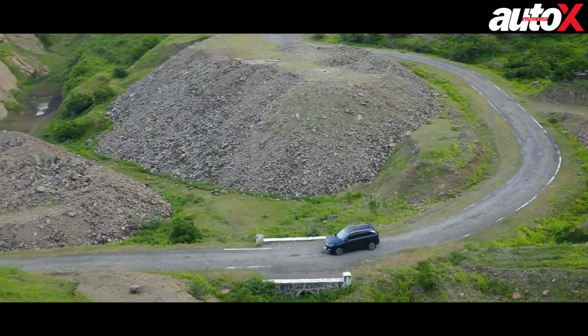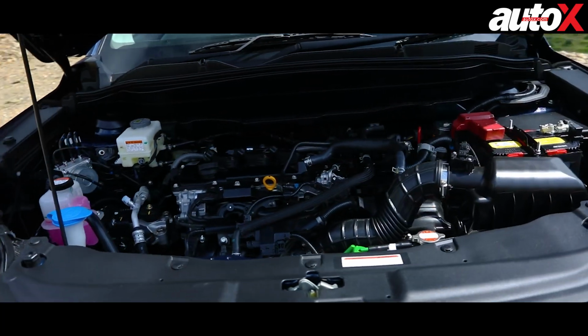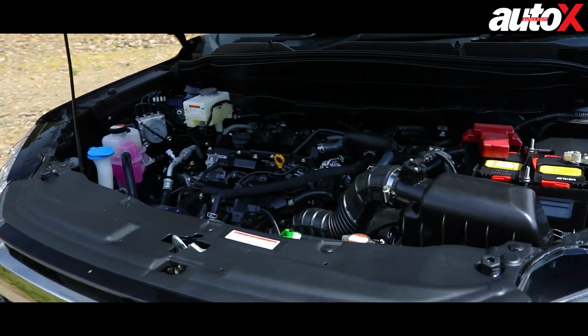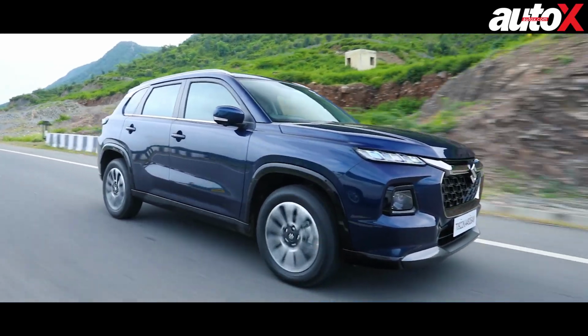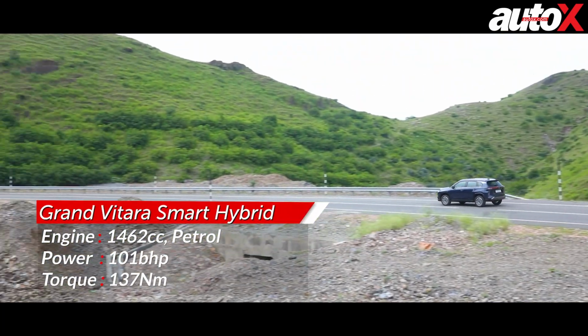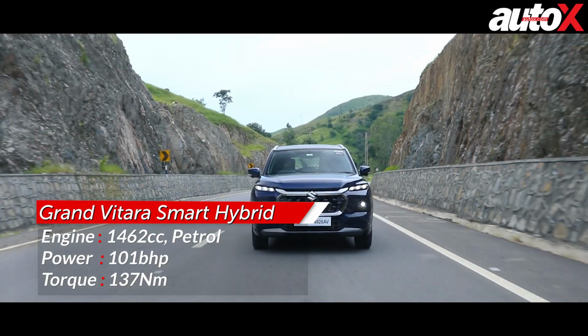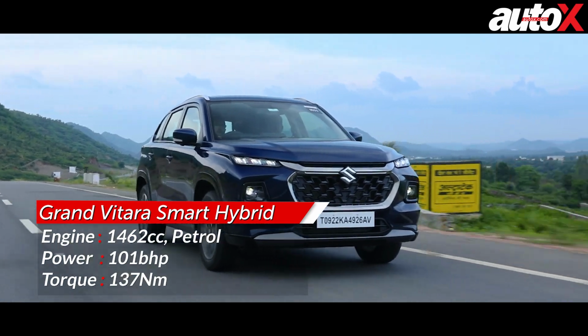Okay, so now we are on the road. We've left the off-road bits behind and we are driving the strong hybrid variant of the Grand Vitara. What is the strong hybrid? So this is a 1.5 litre engine. It's not the same 1.5 litre engine as the mild hybrid. It's a little bit confusing, so bear with me. But yes, it's a completely different 1.5 litre engine from that. It's also connected to e-motors and a full proper battery system. The total system output for the strong hybrid variant is 113 bhp. However, there's no exact total torque figure for this variant.